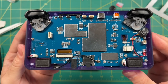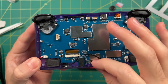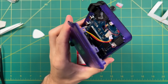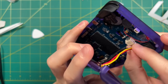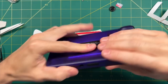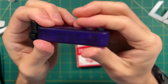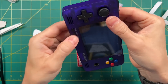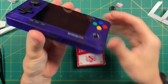This is what the fully assembled PCB is going to look like — speakers in place, Wi-Fi connector, display ribbon cable, all the other little things good to go. Go ahead and plug in the battery cable — just a matter of sliding it in very carefully. We're ready to put the shell back together. Snap together the bottom of the case and work your way up to the top. Squeeze everything and make sure it's in proper place. Push on all the buttons and make sure they are good to go.